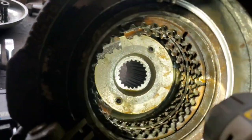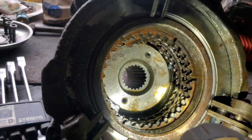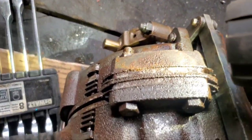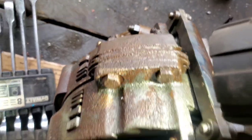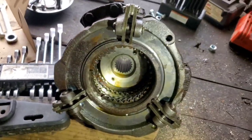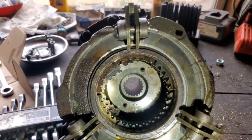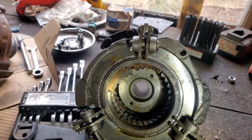Let me get in here and see these teeth. See those teeth? They are not pointed or the same length anymore. Look at this — that's how far shimmed that thing was. I'm sure that the high side was metal on metal — like, no question. We'll see once we get it apart, but I'd bet a hundred bucks. That's beyond where you should safely adjust it. Instead of the clutch plates slipping a little bit, it just grabbed metal on metal and grenaded itself.